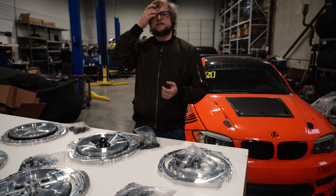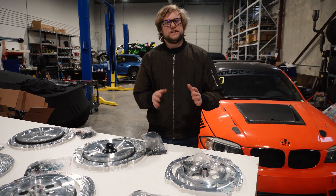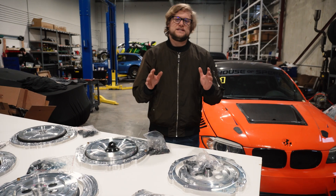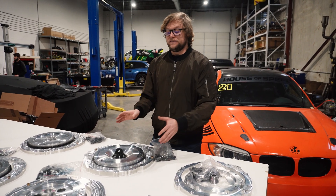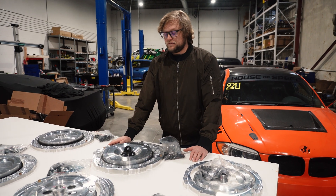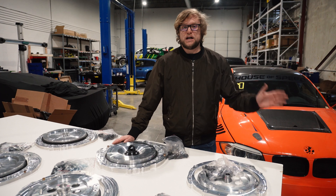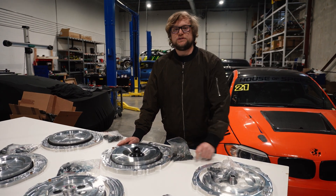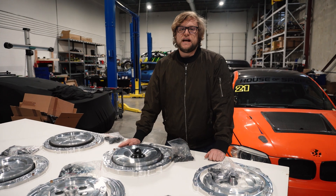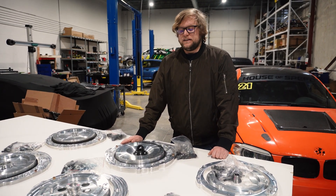Those are limited in the U.S. to mostly an 8HP50, which we have in this car. The 8HP50 is good for around 700 torque if you're being careful. The 8HP70, on the other hand, is pretty common in Europe in this configuration for diesel cars, but impossible to find here. So what we do is instead run these adapter plates, which are made for the Dodge Charger, Challenger V8, 8HP70 and 8HP90 transmissions.